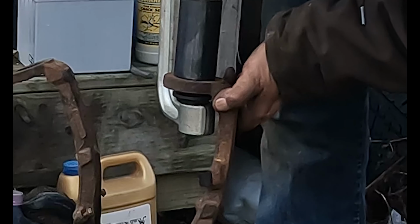And then in the top of the caliper, it has this bracket here that I'm guessing helps hold the tension on the pads to keep them from wobbling. I don't know. I mean, I've never run across that in anything else I've ever done. So, just kind of weird setup. So to put the squeaker on, there's a little notch here that this part of the squeaker goes on. So it just slips on tight fit.